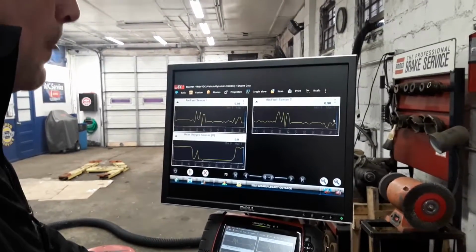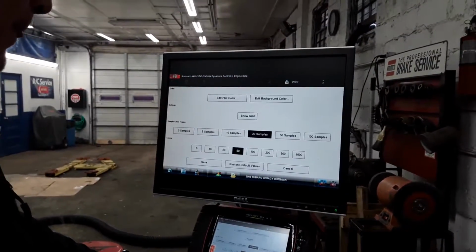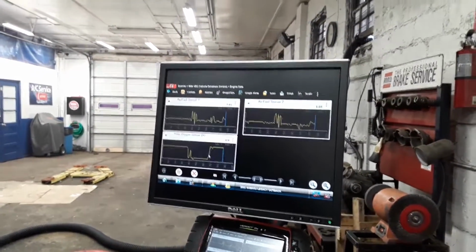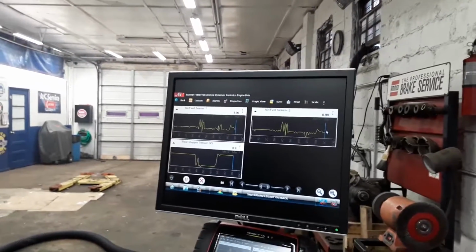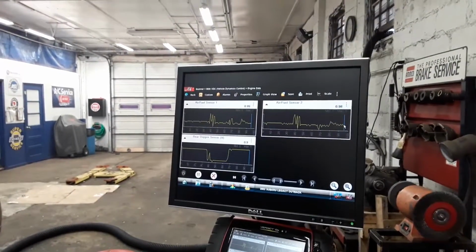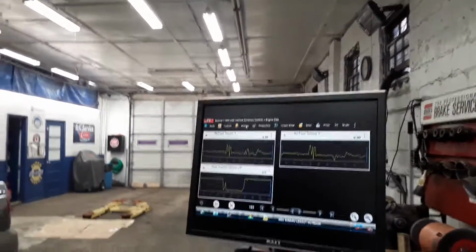Okay, so let me just see, because I think he's just got aging O2 sensors. Let me come over here. That's too slow. And actually, you see, this sensor one is kind of lagging. It's not adjusting. You see how we're getting rich, lean, though it's coming up. It still has some performance to it. Let me hold on a second.